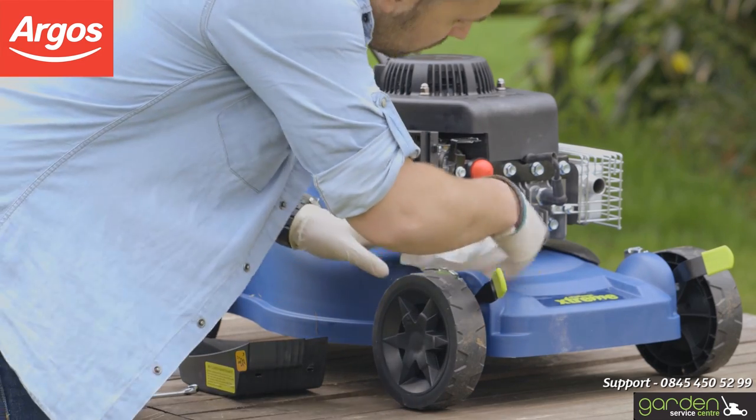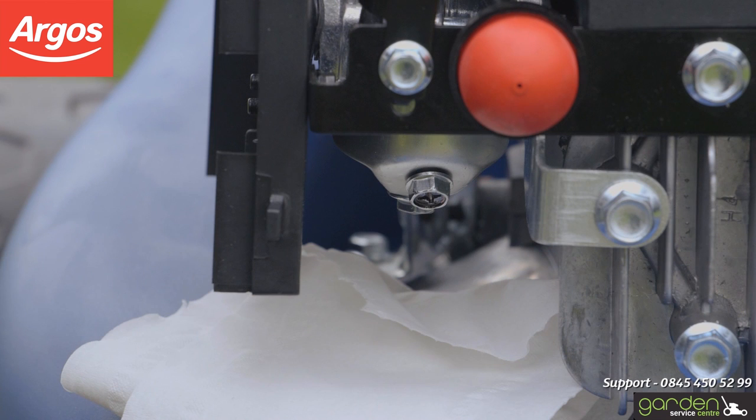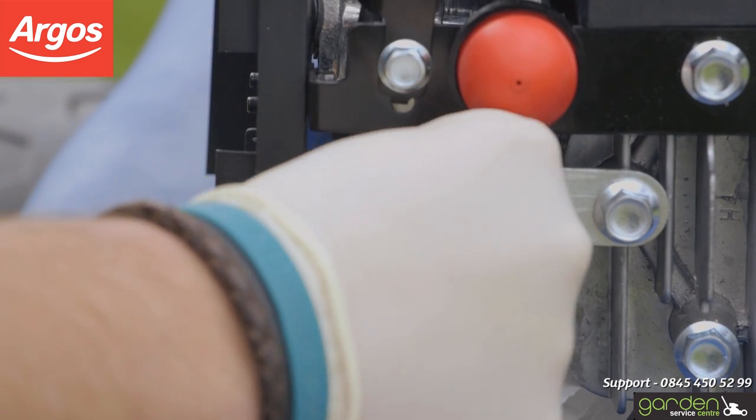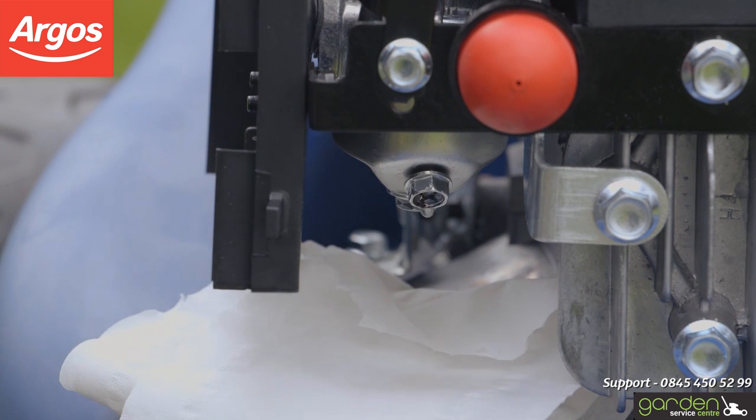Underneath the air filter box, there is a nut that needs to be loosened. Make sure you know which nut to unscrew. It should be the frontmost one, indicated here. Unscrew the nut slowly, but do not remove it completely. Fuel should start to drip out. Once a regular drip has started, allow the fuel to drain until enough has expelled to fill an egg cup.